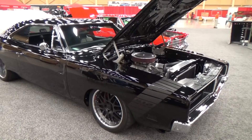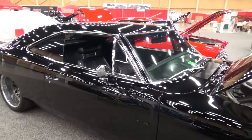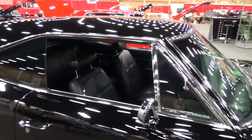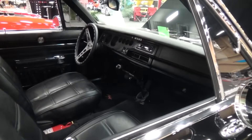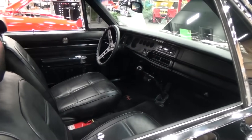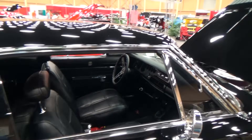The rear end is painted that same color, and we carried a theme throughout where everything is either black, matte black, or that titanium color. Obviously a Roadster Shop chassis? No, it's a stock chassis as far as the frame rails go — we just modified it a lot in order to put that four-link in it. It's a triangulated setup with coilover shocks.